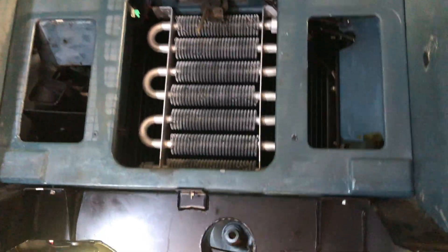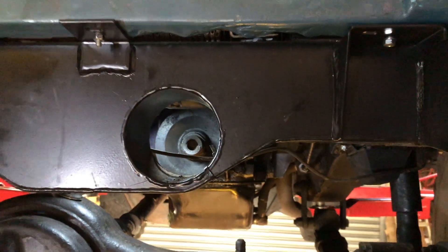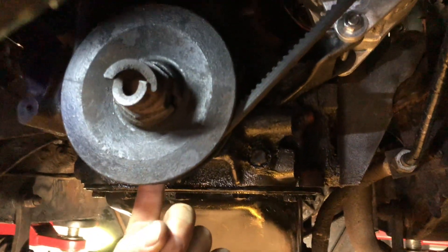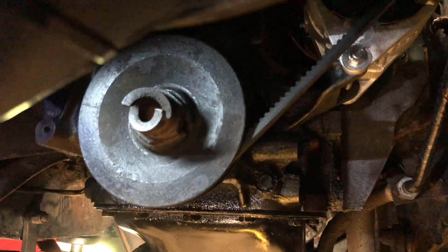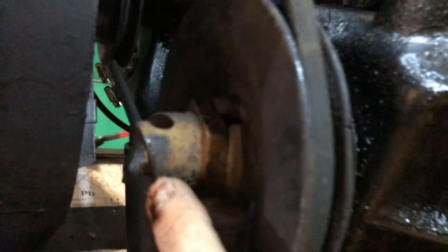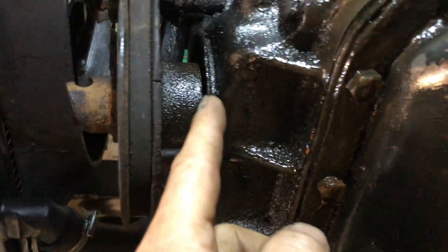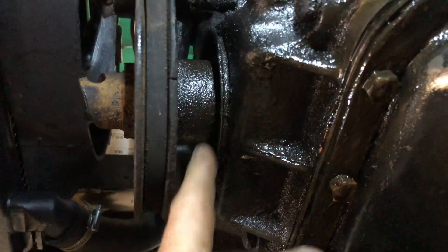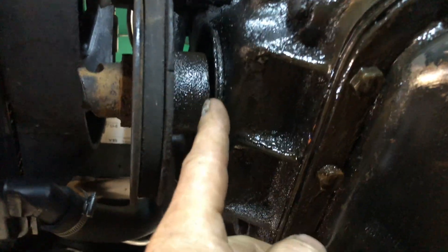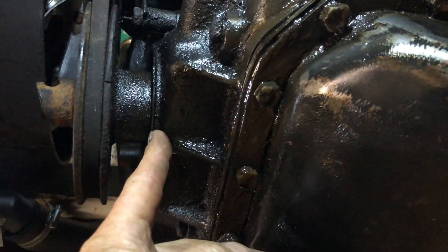Here we are at the front of the vehicle. That's where you put your starter handle through there. The pulley wheel, what we're looking for, is up behind there — that's where it's leaking. Here we are underneath the engine. There's the dog nut, the pulley wheel there. And the seal that's leaking is there behind that flange. We've got to take that off, this off, that has to come off, and then the seal is in there, just behind it.